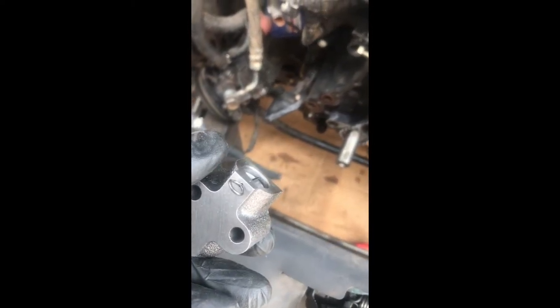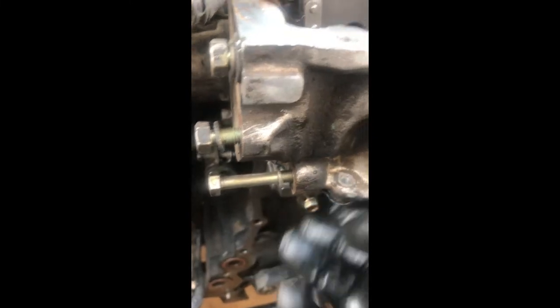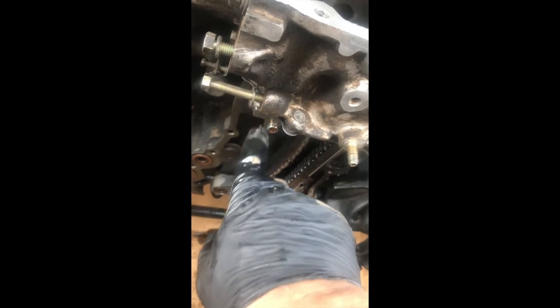I'm using my old bolt because it didn't come with one. The torque for the tensioner bolts is between 5.1 and 5.8 foot-pound — not much at all. I had some trouble putting the tensioner in because it was pushing on the guides. It's held in place with two 10mm bolts. What I ended up doing was loosening the bracket, taking the guide out, putting the tensioner first, then putting the guide back — and everything was good. Tip: put the tensioner first, then the left guide — it's much easier.